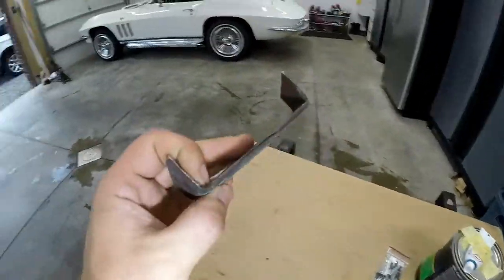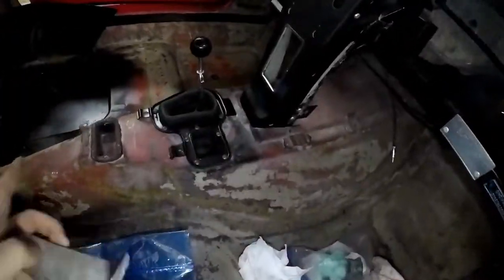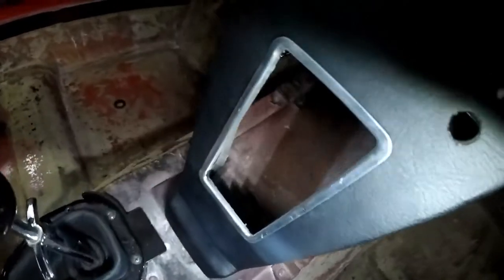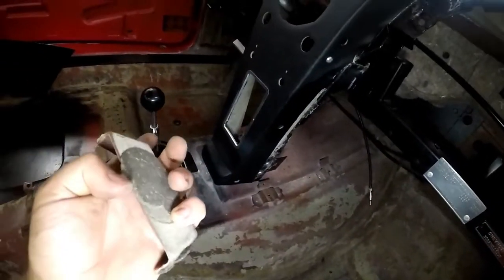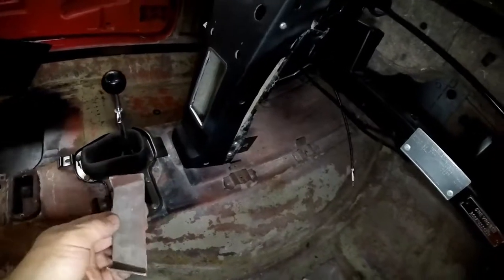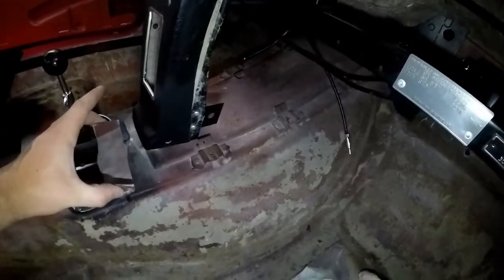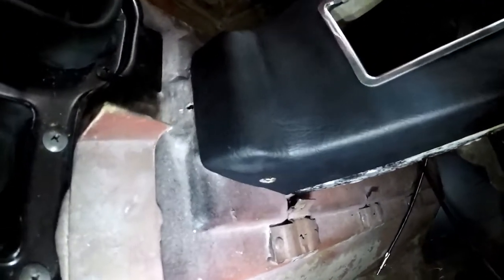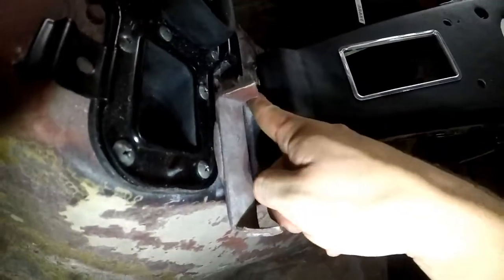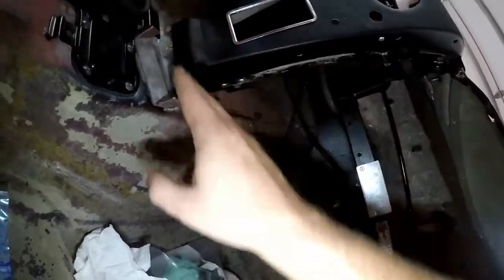Here's a better example. This is the bracket that goes in the dash. It mounts on the floor right where you can see the outline of a circle in the back part of the bonding adhesive. It locates the dash so it doesn't move side to side. It fits the inner corners, and right below the dash in the front, right above this hole, there's a little tab that bonds the front of the dash in, and this bonds the sides.